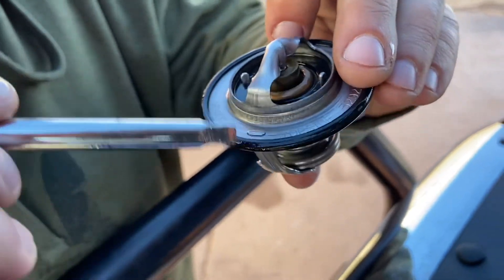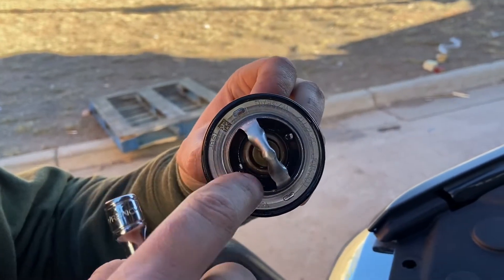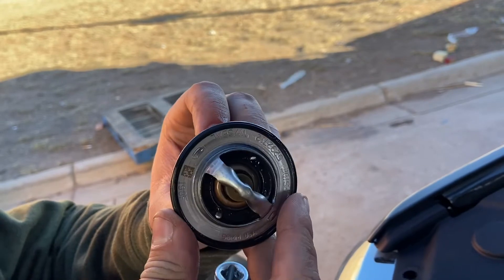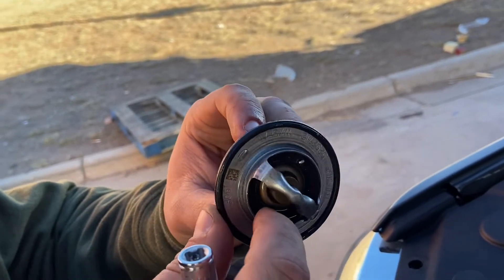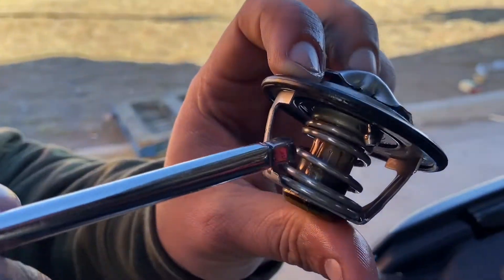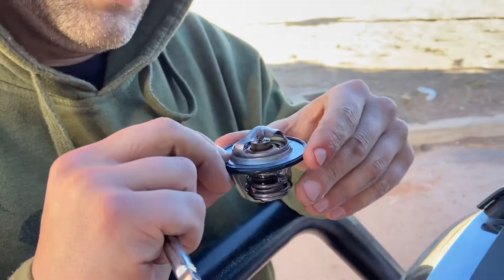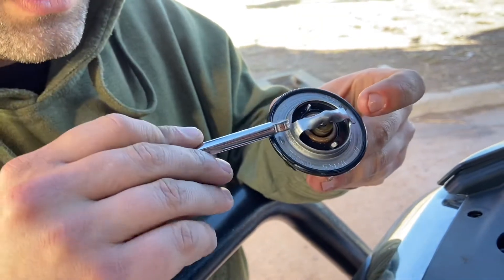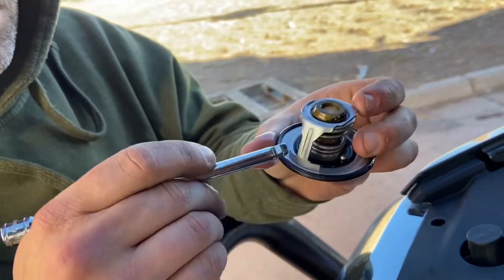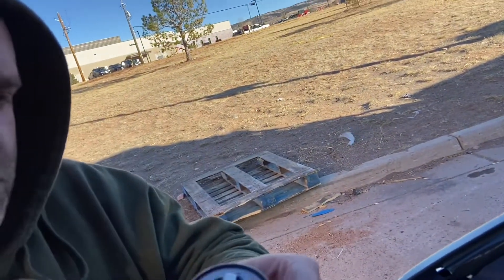It's kind of restricted — you can see this is the whole surface and coolant will only pass through this small opening. There are two small pieces that I'm actually going to pull out so I don't send them inside the engine or radiator. You can see there's a lot of friction and that's not supposed to be like that. So what we're gonna do — this is something I learned back in the day doing race cars — you cut here, here, here, and here.